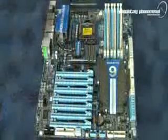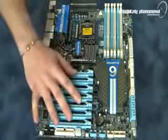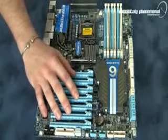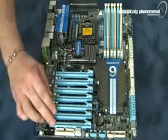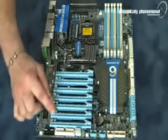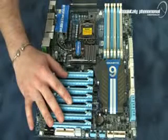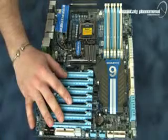One of the first things you notice and immediately grabs your attention with this motherboard is the 7 PCIe slots. Now this motherboard does have 2 NF200 chipsets on board, so what you will end up with is 4 x16 lanes and 3 x8 lanes. This motherboard is perfect for running SLI, 3-way SLI, 4-way SLI and even up to 4-way Crossfire X.